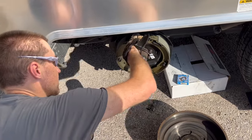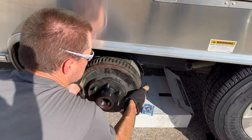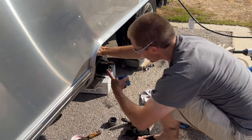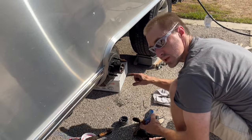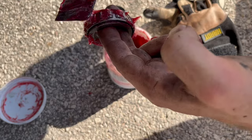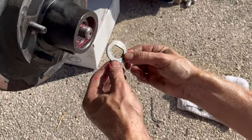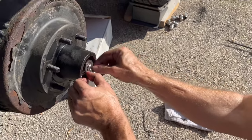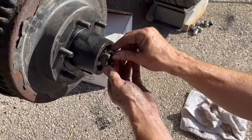I'm regreasing the spindle with fresh grease. I didn't see any signs of rust but there was a slight rusty color to the grease I wiped off. Mr. Tommy basically said you can't have too much grease. To reassemble, with the drum on, I'll take the smaller outer bearing, pack it with grease, put it on, then add the washer, castle nut, and cotter pin. When greasing, get grease on every surface and rotate slightly to work it into every crevice. Notice the washer isn't round on the inside — there's a slot on the axle so this washer can never spin.